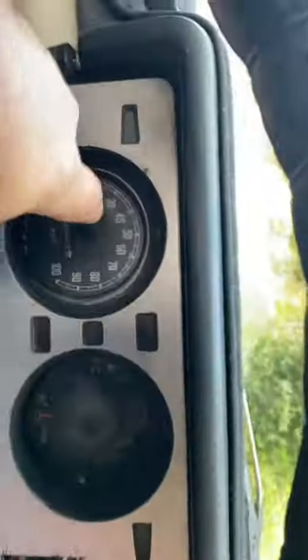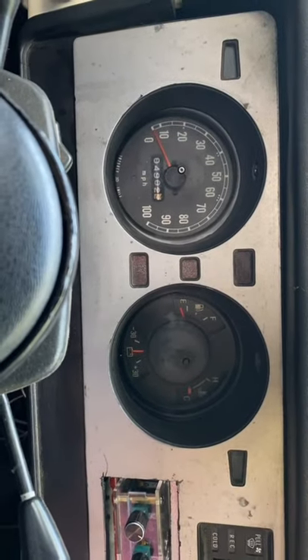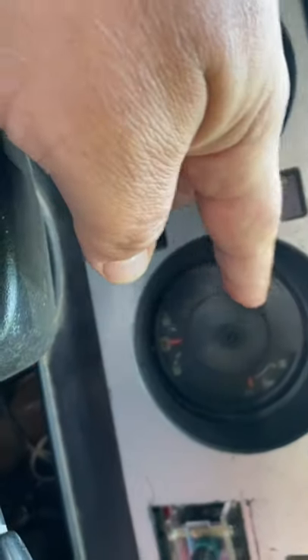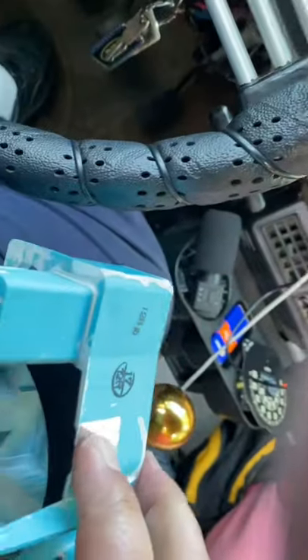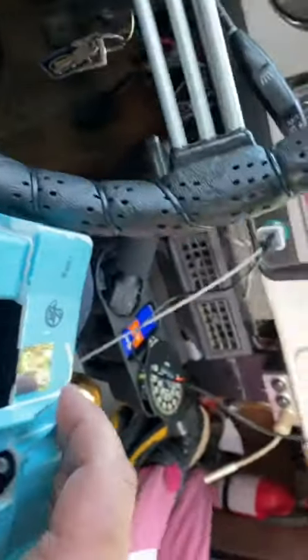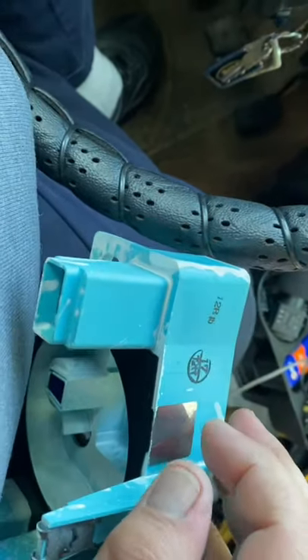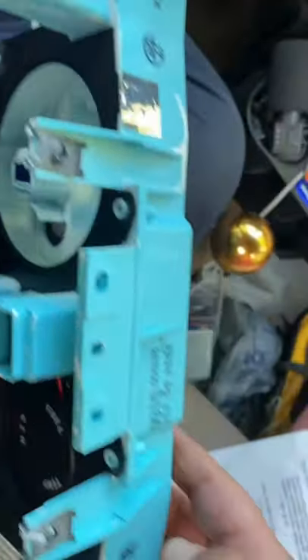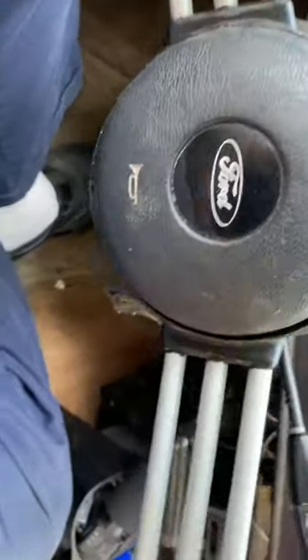Because the lenses had cracks, we're going to use these lenses since they're in better shape. You can see on the video where it's fogging — I'm going to clean these really well. And I'm going to drill a few holes, top and bottom, and I'll probably take a piece of copper tubing or a brake line and put a little 90-degree bend — or maybe drill a hole straight out of the back. That will let it vent so it won't build up moisture. Of course, living in Oklahoma, I'm probably not going to have this problem anyway.